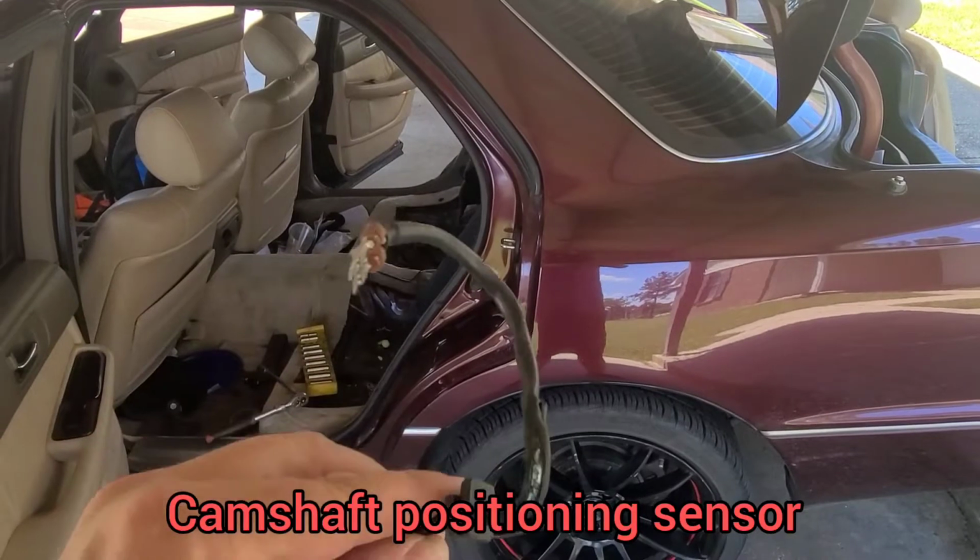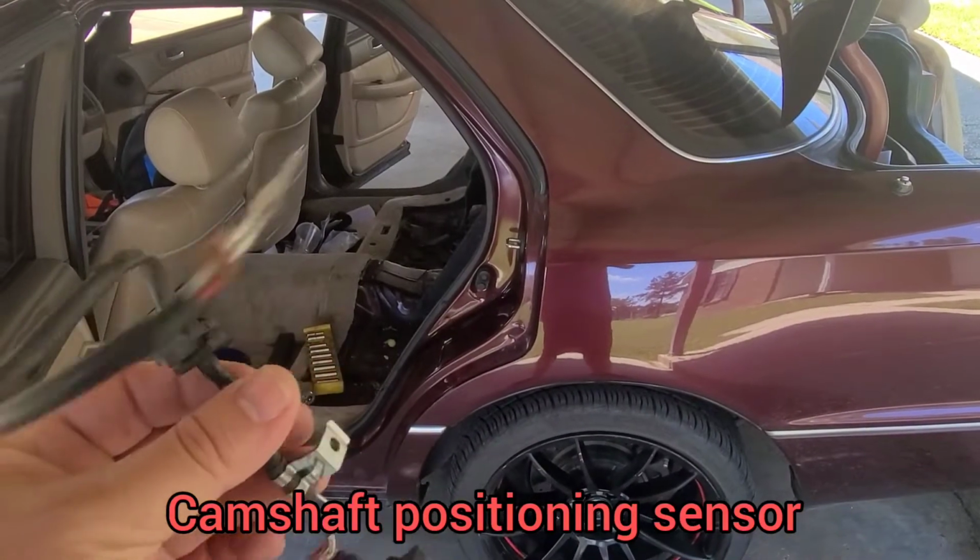So luckily I had a new one in the house and swapped it out, along with a new plug wire that goes from the coil to the distributor cap on the driver's side, because it comes outside the spark plug covers to a coil. And yeah, it was also grounding off on the block. Fixed those two things, and put a new distributor cap and rotor on it, because if you remember from the intake video, I broke the distributor cap where the coil wire goes. I went ahead and replaced all that. This car runs smooth as silk. So it's running great now.